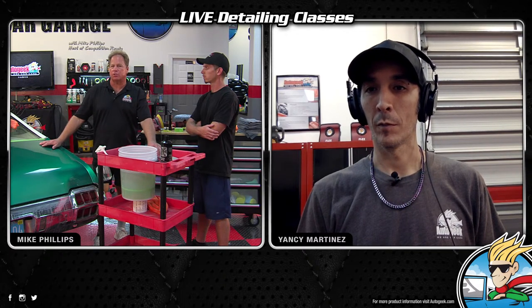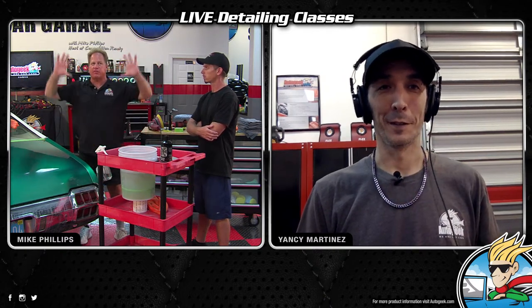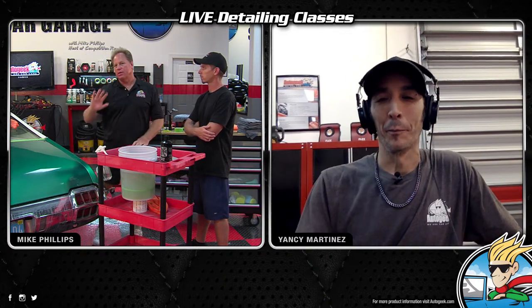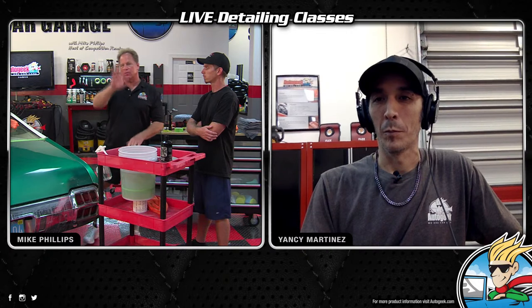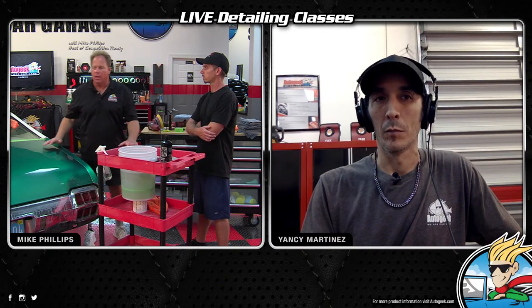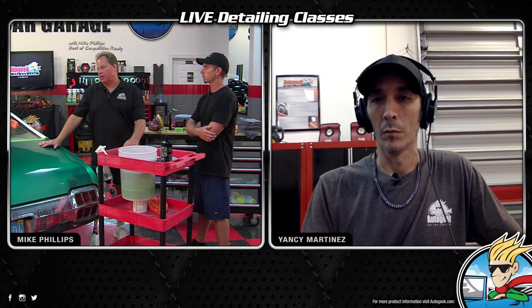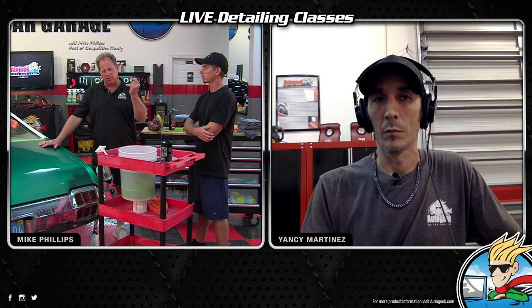We did it to the Meguiar's trucks. We used the X pattern on the Meguiar's trucks. Now, we're talking about huge trailers, big flat surfaces where you can do this, and then you could do this, and then you could do this and knock that peel down and get them flat. They put 10 coats of clear on those trucks. But for stuff like this, just keep it in straight lines. I did 2000, pulled my sanding marks out like that.